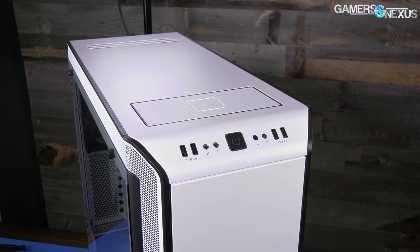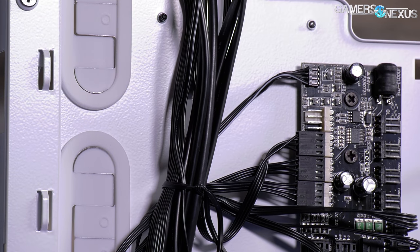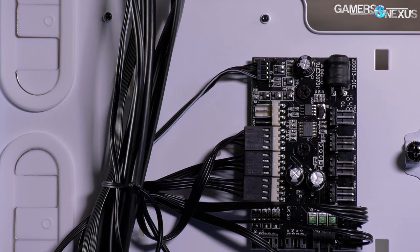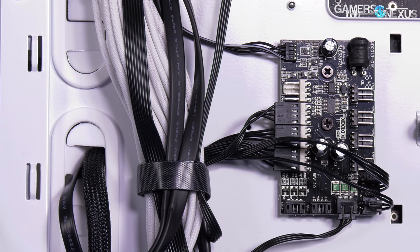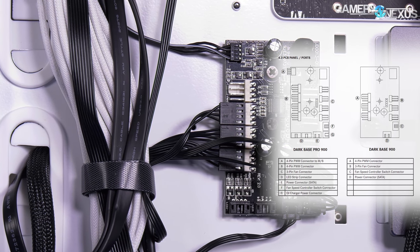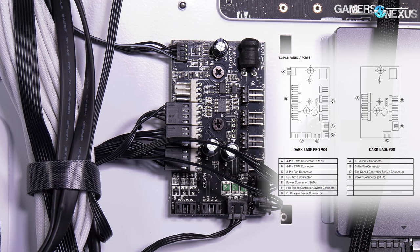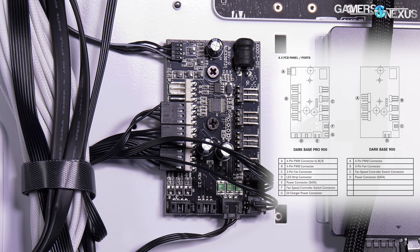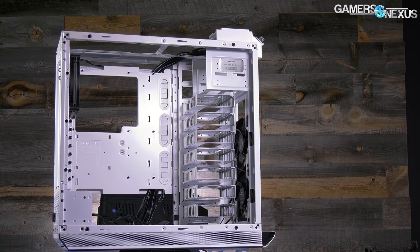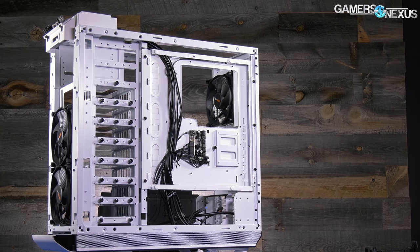The fanciest pieces of hardware included are the Qi charger and the fan controller PCB. Nobody at GN HQ has a phone capable of wireless charging, so we can only speak for the fan controller. The deluxe version included in the Pro case has four each of the three and four-pin fan plugs, two LED connections for the two included RGB strips — unfortunately adhesive rather than magnetic — and an option for PWM control in addition to the standard manual slider on the front of the case. When connected to the motherboard, this allows the PC to control fan speed when the manual slider is turned all the way down. LEDs can be switched to red, green, blue, white, or orange. The free-floating hard drive slots are familiar from past Be Quiet cases and are as good as ever — each slot in the rack is held in with three captive screws and can easily be removed to improve airflow.